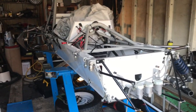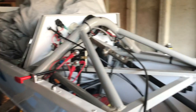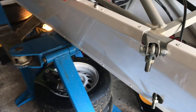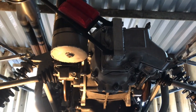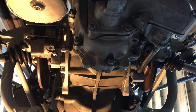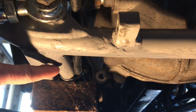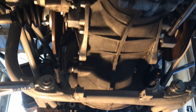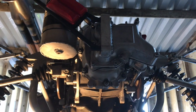My major concern was a crack I found in the powder coat. So I pulled off the right hand panel and investigated. Thankfully it was just in the powder coat — I rubbed it down, primed it and then painted it with gloss paint. It's not a good colour match but it's out of the way. When I was underneath the car cleaning away the mud and grass following the spin, I noticed that the chassis had been in contact with something — this area just here had been ground down. So I imagine that's what bottomed out at Paddock Hill Bend and caused me to spin off into the wall. Well, that's what I'm telling myself anyway.